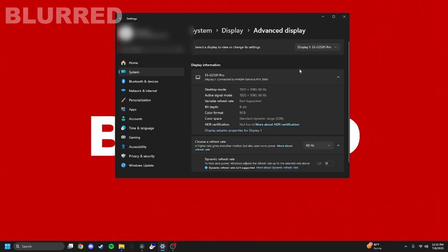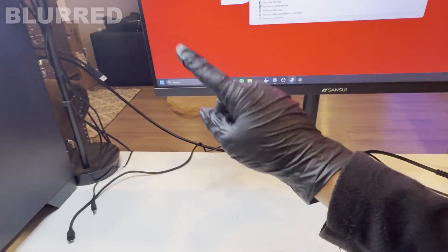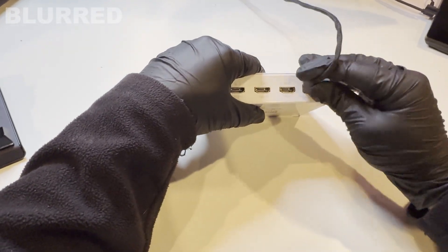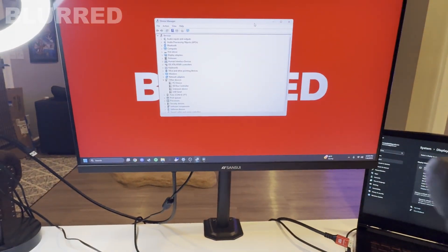Hold K4 again to get back to the main PC on HDMI 1. Some of you might notice you're stuck at 60Hz. I'll show you how to fix this to get the maximum refresh rate for your monitor by flashing EDID. For flashing EDID, have absolutely nothing connected to the fuser — connect the monitor directly to your PC via HDMI with no fuser involved. Then connect a USB-C cable to the fuser and also connect the power cable. Only the D1 light should be on and no HDMI cables at all.